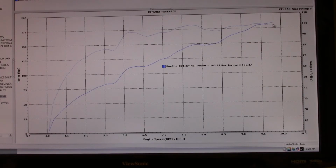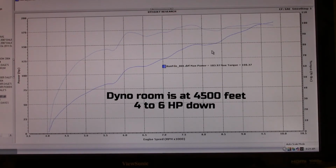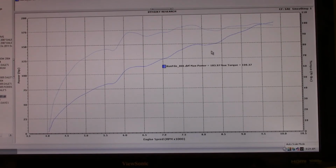But even shutting it off way early and with no tuning at all yet, the thing made 184 horsepower. So that's pretty stout, because you got to remember I have the car tire, 8.5 inch Mickey Thompson. It's a lot heavier than a Pro Street tire Dunlop they got these days. The rim's heavier. I have a 630 chain. I got the real cold C16 race fuel, really made for nitrous. And my engine's kind of set up for nitrous, the cam timing, how the cams are designed, and the compression. So that's pretty stout for just one run laying it down.